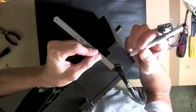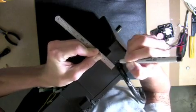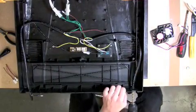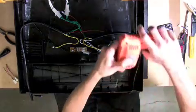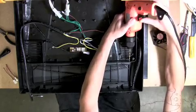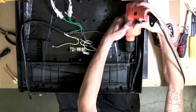Using a permanent marker and a ruler, measure up approximately 1/2 inch from the black cable on the right side of the canopy. Using a power drill and a 1/8 inch or 5/32 inch drill bit, drill a hole through the back of the canopy using the mark that you made previously. Then drill a second hole through the inner wall of the canopy so that you can run a DC jack power cord through the holes.